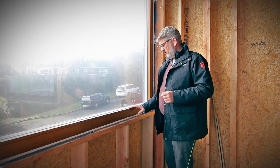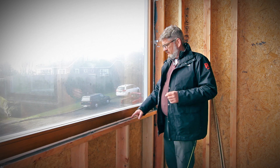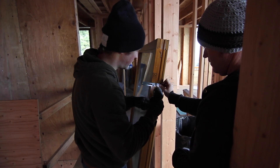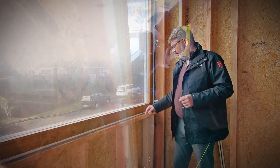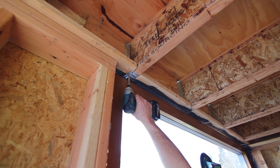The window goes in. Right here we've got, as an example, this fastener clip. This fastener clip goes to the outboard side of the window frame and screws in in two places. These clips are placed at a sequence dictated by the manufacturer, and then an additional fastener is driven into the framing. So these clips are essentially what holds the window in structurally.